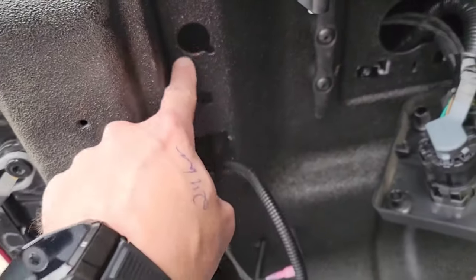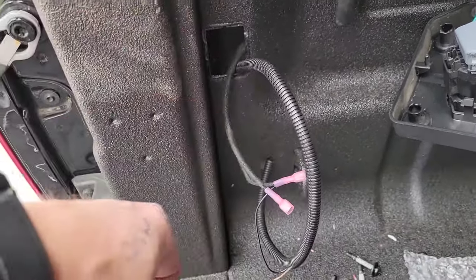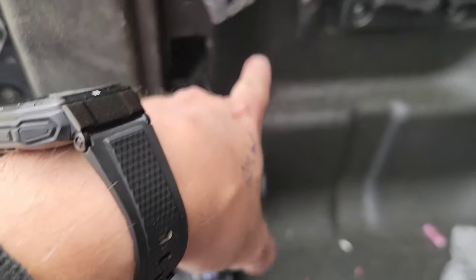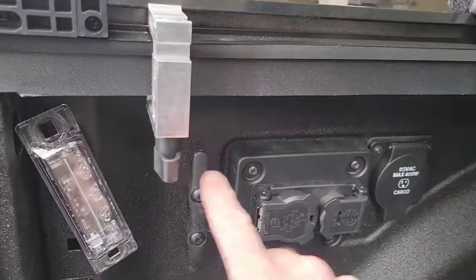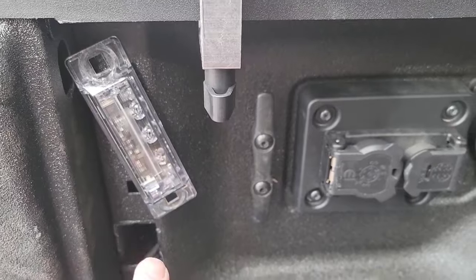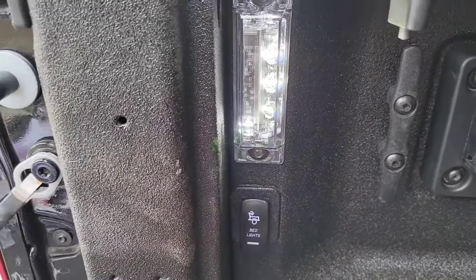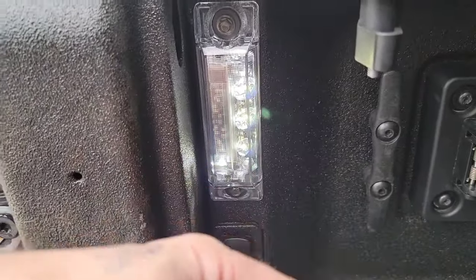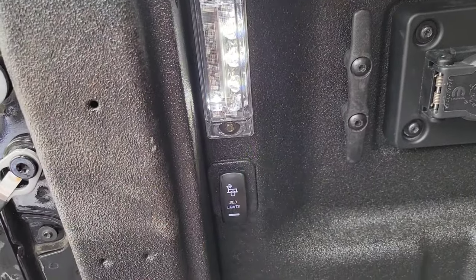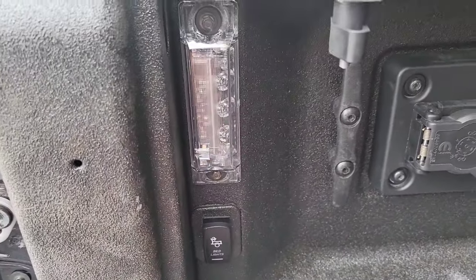You might be wondering where the wiring is — once we have this connected it'll be as if we ran it to the front of the truck, then we'll plug it in down below. We got it buttoned up, everything plugged in and cleaned up. If you want to add more LED light strips, this is the time to solder everything together. The lights are ample enough to supply the light. There it is installed — looking good, and we got power. It has one LED that shines toward the middle of the bed and LEDs that shine forward.